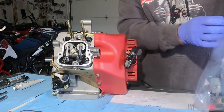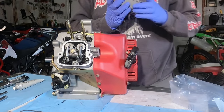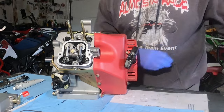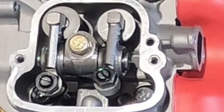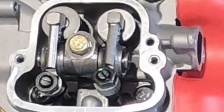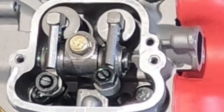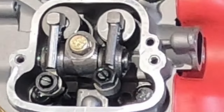Putting on the cam cover. My brother's a jet engine mechanic — he can do this in his sleep. He's been working on jet engines for about 30 years, so he's probably making fun of my archaic machine. Whenever I took the valve cover gasket off, it did disturb a little bit of the gasket on here. I'm using the 3-bond 1184 — this is what I put on the back case on that seal too. This is some of the gnarliest stuff you've ever seen in your life. You can do metal to metal with it.